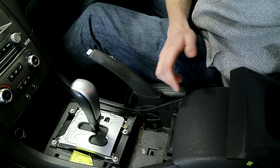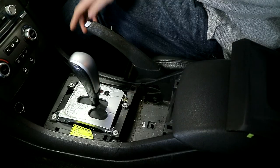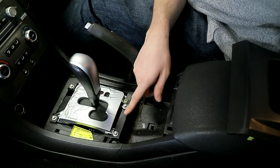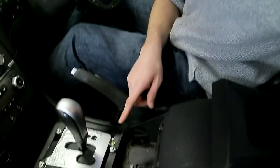Should just be four bolts around the outside to take off. But that shifter is actually underneath this center console. So to get that we need to remove the center console, and to do that we need to remove the handbrake, and to get to that this driver's seat needs to come out as well — just to fix that wrinkled plastic.